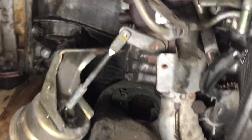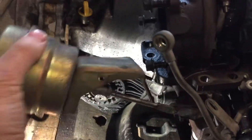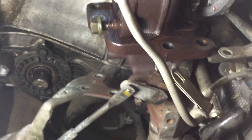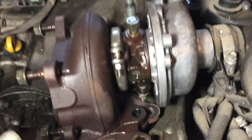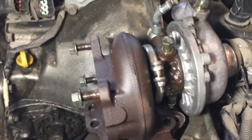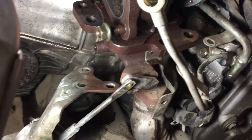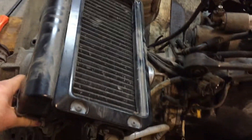It'll open up this gate here — this piece is pulled off but normally sits up there. It's got a little flap valve in it that basically works like a wastegate, and that's what spools up the secondary charger. The secondary doesn't have a wastegate in the exhaust housing itself — it's just that valve right there in the up pipe.